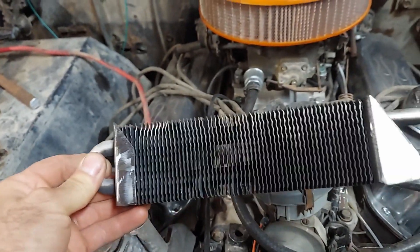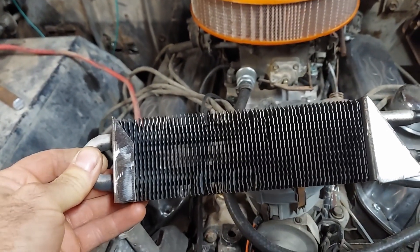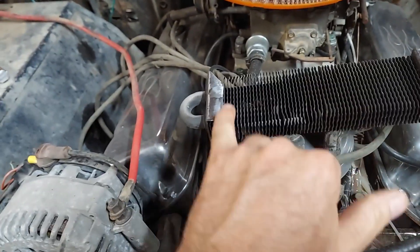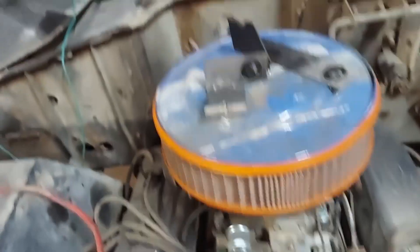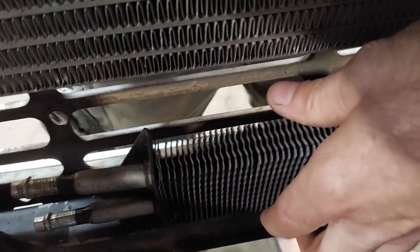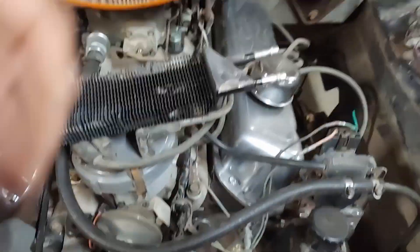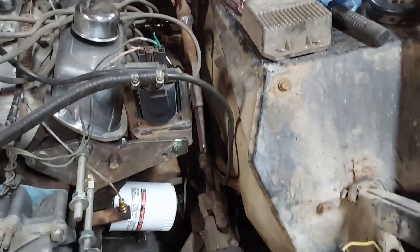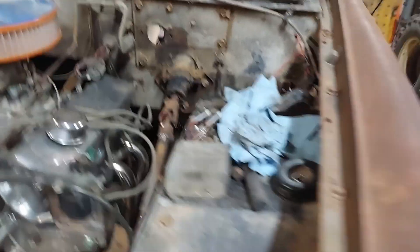I'm going to be cutting it off on the top mark, cleaning this U-joint up, getting this stub off of it, and I'll just be welding that right to there. Also got the power steering cooler figured out — this is a power steering cooler off of a V8 Explorer. I could not find a way to make it fit with the existing brackets so I cut the existing brackets off. I'm going to reconfigure them and it will sit on this little cross member here in the grill support right in front of the radiator.